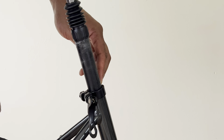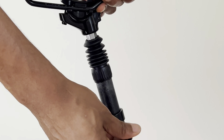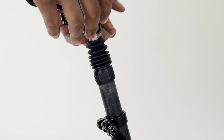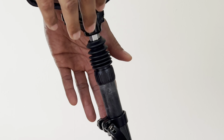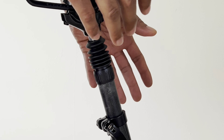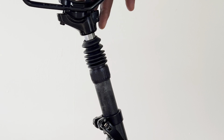Occasionally the seat may shift to one side or the other and won't be aligned properly. So line it up, set it to the appropriate height, and then go ahead and tighten it. Remember how I loosened it up — you'll want to tighten it a little bit before you close the lever. Screw it clockwise to tighten it. When you close the lever, it should have a little bit of resistance, not too much. Make sure it's aligned and at the perfect height. Remember to read your owner's manual because every bike is different, made of different materials, and requires different pressure to close and tighten.